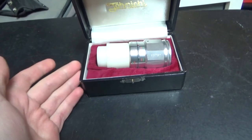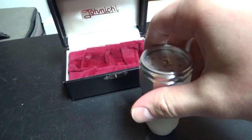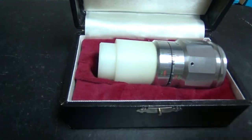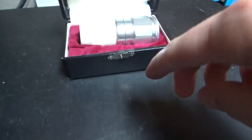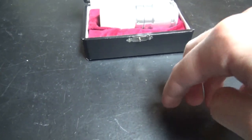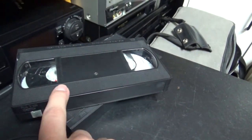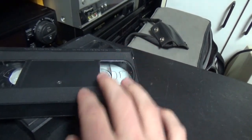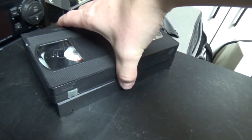It was used to measure and adjust the torque of the VCR motor — the capstan motor — because there were some adjustments you could do on it. I'm not sure whether you use it on fast forward or play, because they don't have the same torque. In play mode, the right spindle is not used for pulling the tape from the other spool — the capstan does that. But in fast forward mode, with the pinch roller disengaged from the capstan, the right spindle is used for turning the tape, so it has full torque.